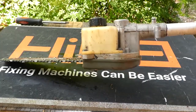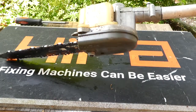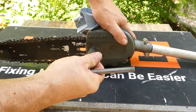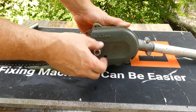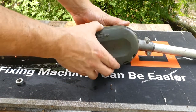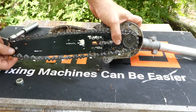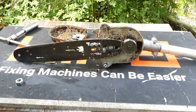Next up, we have the little Ryobi pole saw. These are very simple, based on basically the same mechanisms, but very simple. To take off your cover, you remove the central nut. Like a couple of the others we'll see, the adjustment is actually on the side. Removal of the chain is just like the first saw — just like the Husqvarna. Take it off at the nose and pull it back. This is a very normal way to remove a chain.